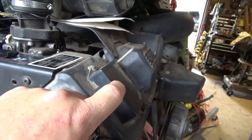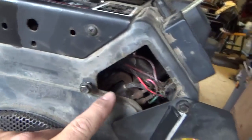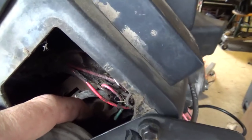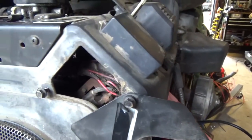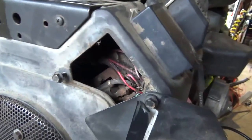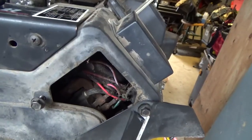They have different names for these systems. What you need to know when it acts up: their corrective action and replacement kit is to go back to a non-advanced ignition system. You know you're at the non-advanced ignition system because the coils have two connections on the advanced version, while the non-advanced version has one connection. A white wire goes to it, and when you touch that white wire to ground you're turning the engine off. You have to touch both white wires to ground — if you don't, instead of turning the engine off, you just make the engine limp along on one cylinder.